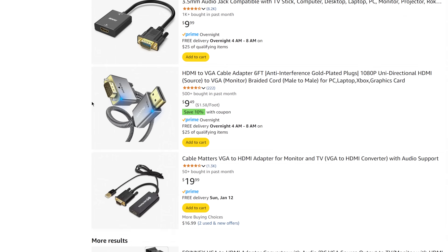If your machines have VGA, not to worry — there are VGA to HDMI adapters that are USB powered, and VGA to HDMI then into this works really well. The VGA to HDMI adapter chipsets available in 2024-2025 work quite well versus older ones you may have had trouble with. For DisplayPort, DisplayPort to HDMI is a bit more challenging. A good active adapter is usually USB powered, and you generally can't go DisplayPort to HDMI and then back to DisplayPort. Make sure you get a good active adapter for maximum signal integrity, though passive adapters have a decent shot at working at 1920x1080. FreeSync and G-Sync are not applicable here.